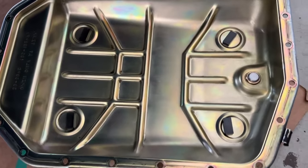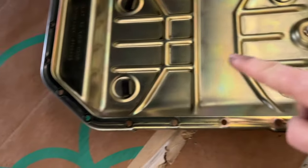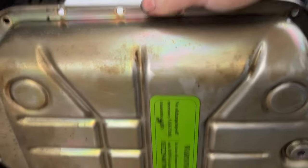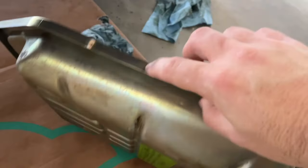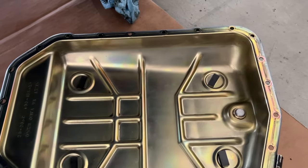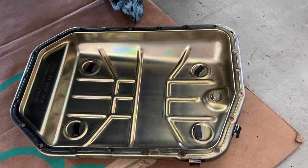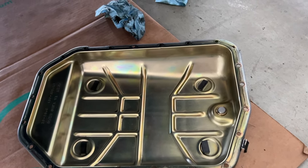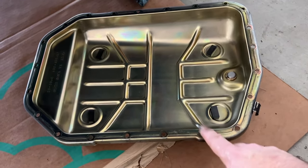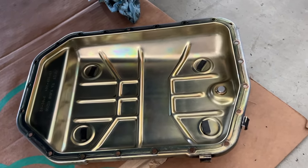I spent a good amount of time cleaning this oil pan — not so much inside but outside. Also check and clean the magnets. The outside looks almost new again. You want to clean especially the groove that goes around the outside on the sides — not just because it looks good, but in case you have a leak, you can at least detect where it's coming from. Plus having the dirt removed reduces the chance of dirt getting stuck between the fastener and the pan, which could cause a leak. So just make sure you've got your stuff clean.